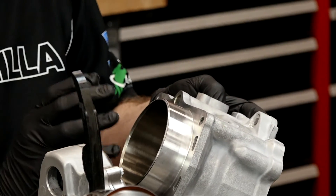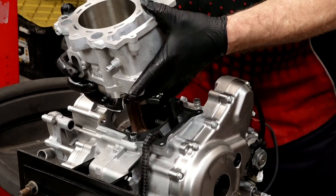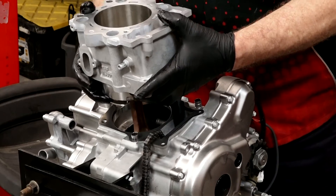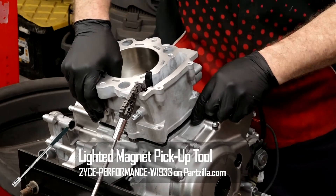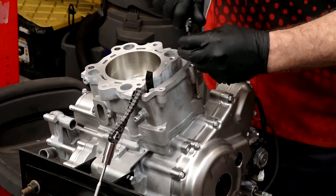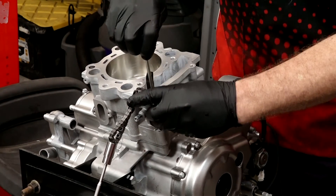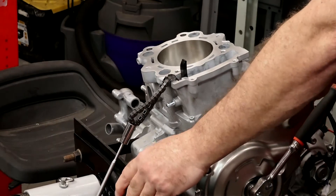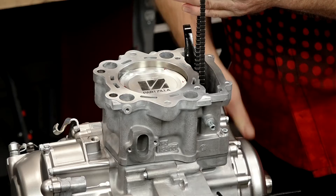We're going to lower the cylinder down and hand-compress each one of these rings up into the cylinder. The bottom of the cylinder has a chamfered edge for those rings to guide in. It can be a little tough — don't force it. We want this to be smooth because if one of those rings gets out of shape, they'll bend, possibly damage the piston, or worse, even damage the cylinder. Once she's in, put in the two 5mm Allen bolts just to hold the jug in place. Turn it over a couple of times, listen to make sure everything is right, bring it around to top dead center, and make sure you're holding the chain up — otherwise it'll get kinked down at the bottom.